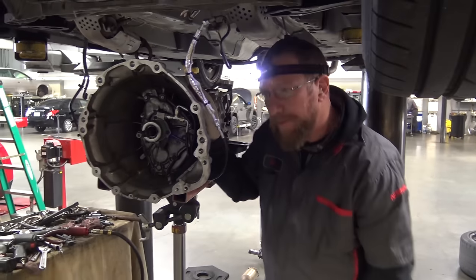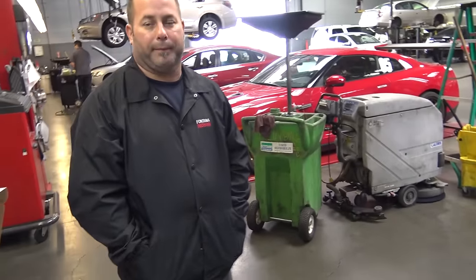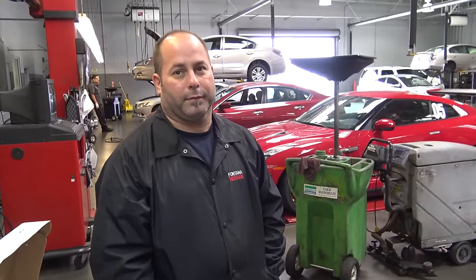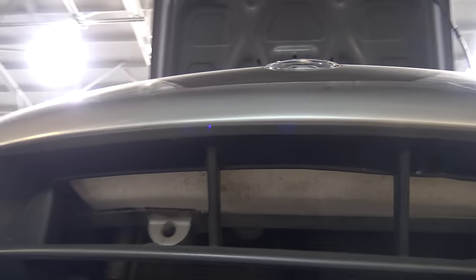Cool. Proper braking, yes. And then the Stillen intakes we're doing, you hear a lot that intakes don't make a huge difference, but apparently Stillen has stumbled onto some science with where they put their MAF sensor versus the length of the tube. So people are seeing real-world anywhere from 10 to 17 wheel horsepower improvements, even though the filters are going to be tucked up above the crash beam behind the nose, so there's not even necessarily a high pressure zone there, so it's not like a ram effect. But you've said you've sold a lot of them and you've had a lot of good experience with them. Yeah, that's our best seller, and really the most effective intakes that we've found to date.